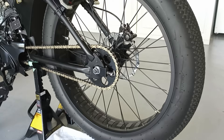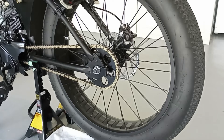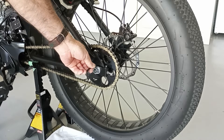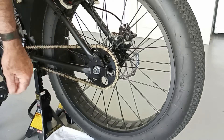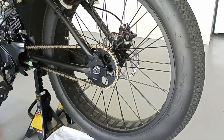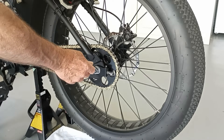Clean them, get them dry, use some Loctite, put it back together, and torque it back. In this one I've done a modification — I'm drilling a hole through the flat part of the frame right here, which will enable me to access the sprocket bolts. My battery went dead but once I'm through I'll paint that so it doesn't rust. This is a steel frame by the way.